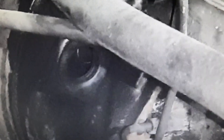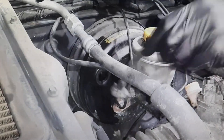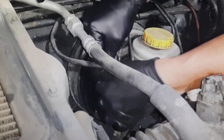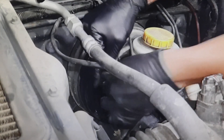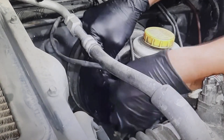If there is brake fluid, that would happen because there is a failure with the master cylinder gaskets. We insert that rope — you see that this test does not take you a minute to do it. We insert the rope and then take it out, and we see that here there are no traces of brake fluid in the rope. So you can know in a very simple way if you have or do not have brake fluid inside the brake booster.